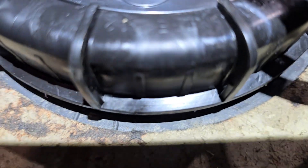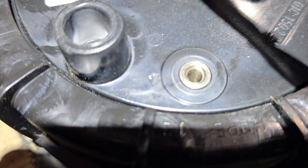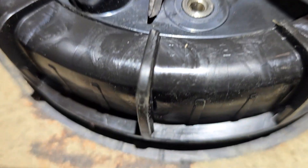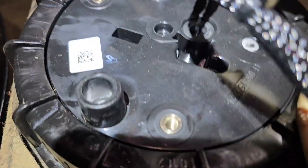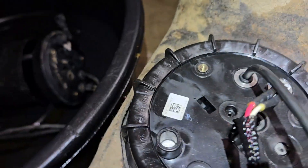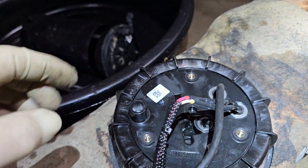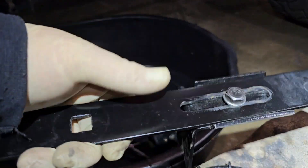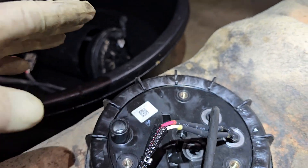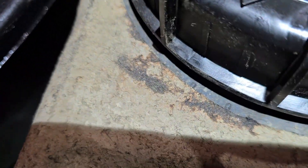When putting the pump back in, pay attention to the reference marks. There are two marks on the tank and an arrow on the DEF heater reservoir assembly — make sure that's lined up, because if it's not, your fluid line won't line up correctly. There are two notches on the tank and the arrow has to line up in those two notches. Once aligned, spin your ring — but make sure your pump doesn't move with it, as sometimes it can turn slightly with the ring. Technically you're supposed to torque this down to 63 foot-pounds, but I had trouble with it slipping off, so I turned it until the arrow lined up in the notches and it was tight.